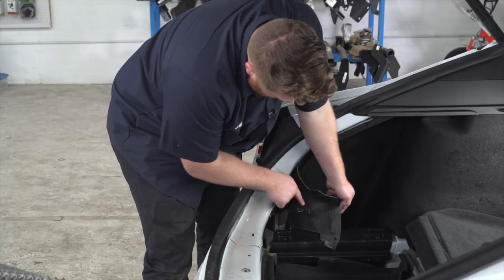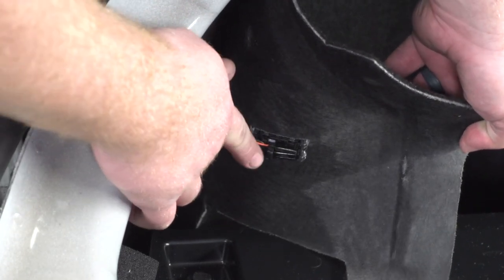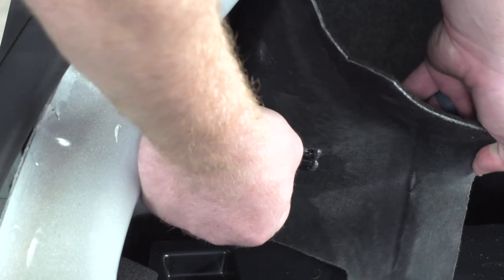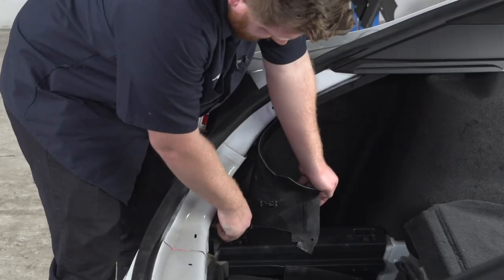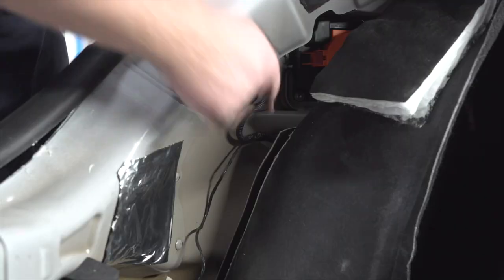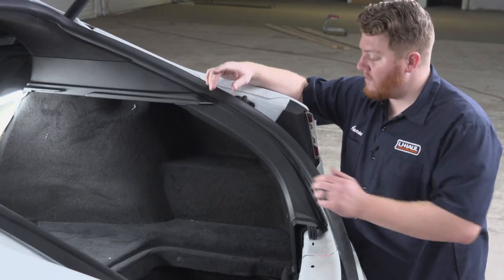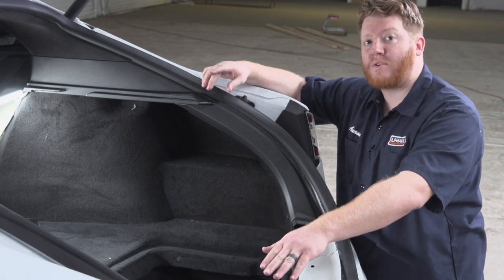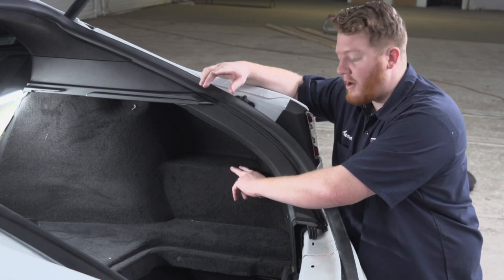Right behind our side carpeting, we have a plug for our light. We're just going to push on the tab right here — it's a really small one — push it down and then pull it out. Now we're just going to pull back on this side paneling, which gives us access to our wiring harness. Now we're going to remove our passenger side paneling following the same instructions as the driver's side. It's a little different on this side so we'll show you how, but let's start by removing these bottom flooring pins.